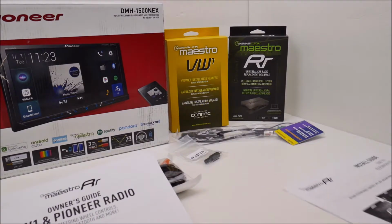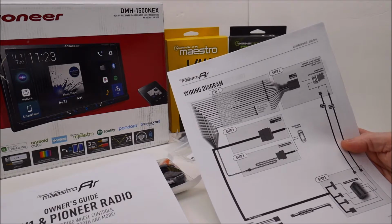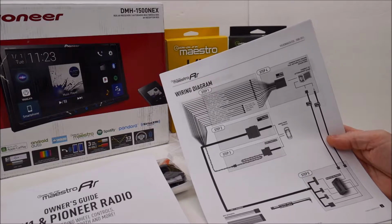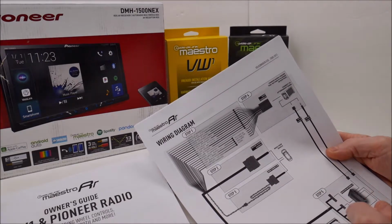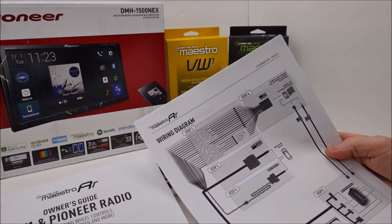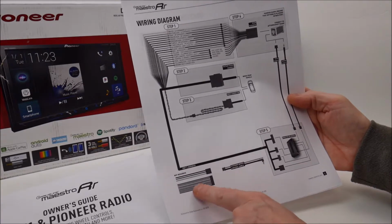This is the owner's guide. I also printed out an installation guide. And the installation guide, we'll cover this in another video when I start putting things together. This installation guide gives you a complete breakdown of what's plugged into the iDatalink Maestro RR and how you splice this VW1 iDatalink wiring harness into the factory Pioneer wiring harness. And I'll discuss that in more detail in the next video when I get around to actually doing this. It also mentions that there will be some cables that you don't need down here.